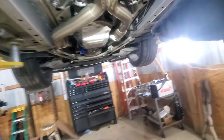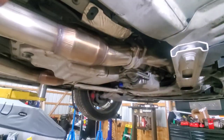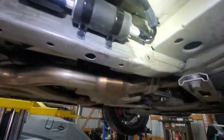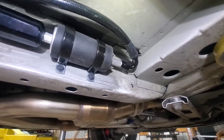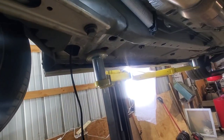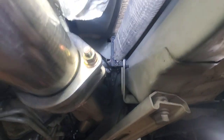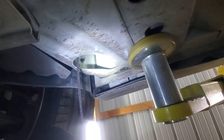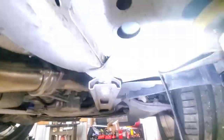Now it's on to the wiring. I think they show it feeding through these holes. Down here is just the two wires, and up top I believe it's two grounds and a hot, and then the plug-in for the MAP. I decided to run these wires that go to the fuel pump down through the engine compartment. There's a factory hole right there behind this bracket, so I took the bracket off — there's one 10mm bolt hole in that bracket — I fed it through in this area, and I plan on coming out that little hole right there and then hooking it to that.